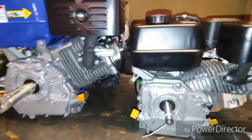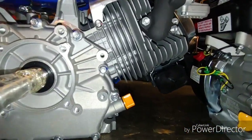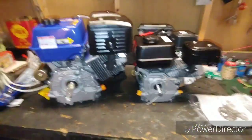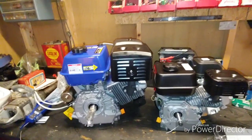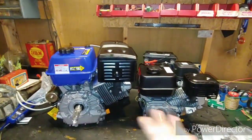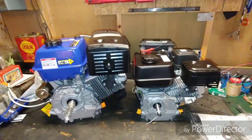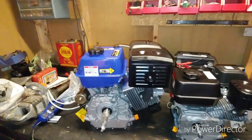The 212 has got a three-quarter-inch output shaft and the Duromax has got a big one-inch output shaft. That's just a little preview of what I'm going to be working on. The 212 is supposed to be six and a half horsepower and this is 18 horsepower — more than double the size, double the displacement. When somebody says small block, they mean the 212, 196, a couple other engines around that size; and big block is the GX390, the Predator 420s, the Duromax 440s.